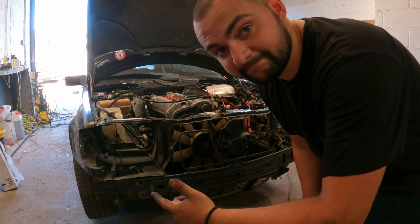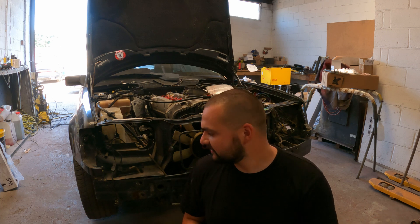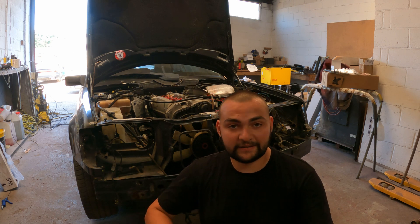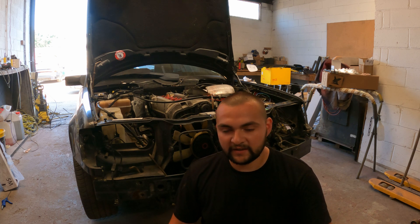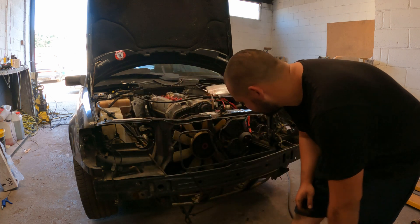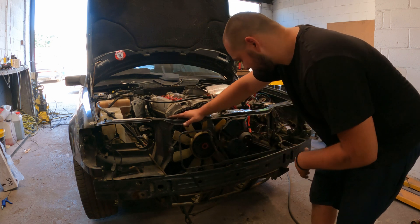The condenser is out — took some beating but it's out now. Apparently you need to loosen the condenser to remove the headlights because there's one bolt over here and the condenser is right in the way. I swept the floor with my floor sweeper 3000! I had to cut the pipes because they just wouldn't come out. The advantage now is I can put a pipe wrench on one side and use the impact on the other side to rattle them off. There's a lot of rust over the headlight area but we'll fix that at a later stage.